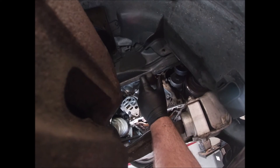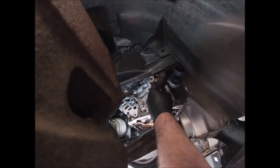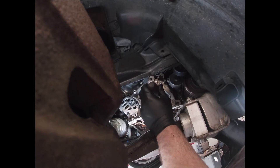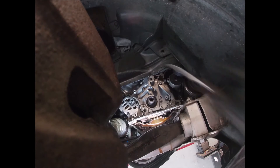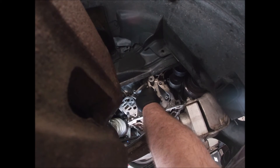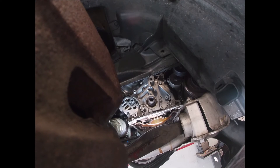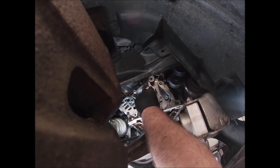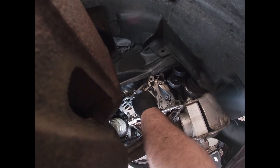That's why I like to do it when it's on the car. Don't be worried about the oil pump housing as much as you should be about the crank. When you're taking that seal out, you can pry a little bit on the inside — the last thing you want to do is mar this surface here, because that's where it's going to leak if anything does. It's not going to leak on the oil pump housing side. All right, there you go.